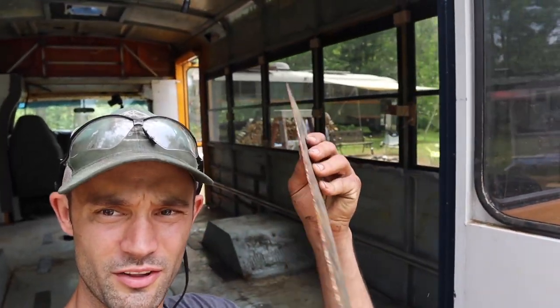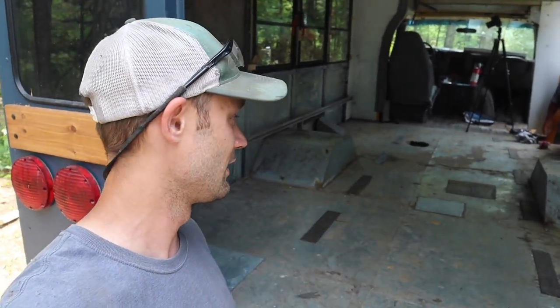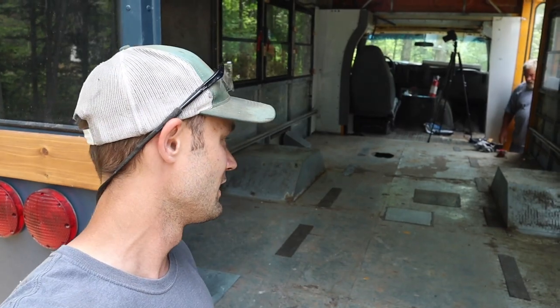I just finished making all my little patch pieces for the floors. There's been quite a few holes in this floor and the easiest thing to do is just patch them. If you've got a big bus and the floors are completely just steel, you can weld them straight through. One of my issues is that we have aluminum on the bottom, so I'm not going to try that — I don't have the welder for it. If you don't know how to weld, there are other options: you can use epoxy to fill the holes, or use pennies, washers, and caulk. We're going to rivet these down and then seal on top to make sure we're completely waterproof.